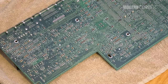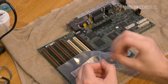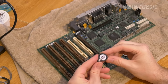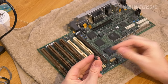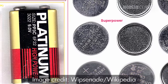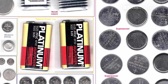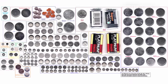This is a simple 3-volt coin battery that should be interchangeable with any number of others. The problem is just that it's not easily replaced. I ordered a CR2032 battery holder from Digi-Key — a tall one to make sure clearance for any other motherboard components was not an issue — and bought a battery from my local Walgreens. The number just refers to the physical size, and as long as I'm putting in a battery holder, I can pick whatever size 3-volt coin battery I want. It makes sense to just pick the most common one with a similar capacity to the original.